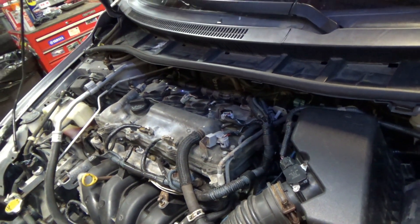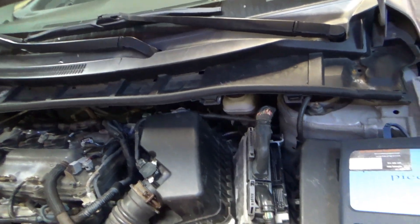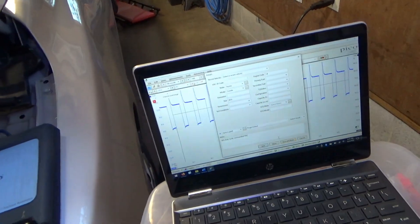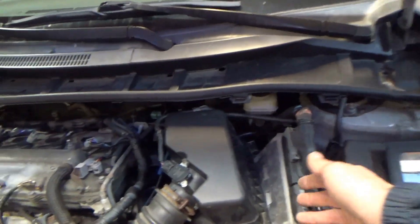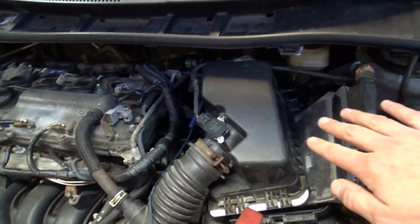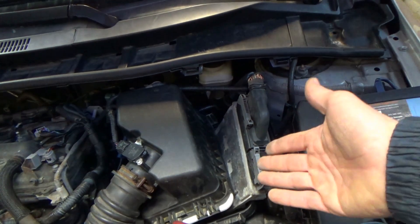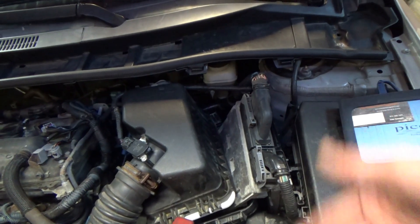No purge control by this engine computer. How crazy is that? Is the driver failing or failed in the original engine computer? I would not be too surprised, because the guy said it didn't click with this one and it clicks with this one — that's exactly what we see. The only question is whether the remanufactured computer is clicking enough and whether that duty cycle is correct.